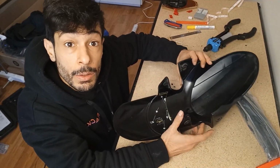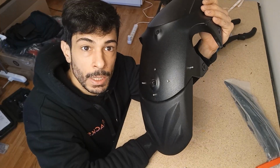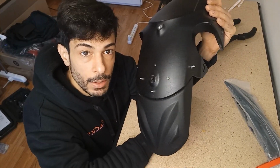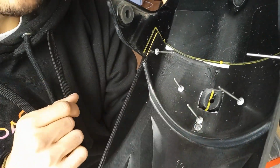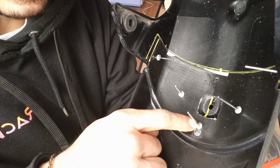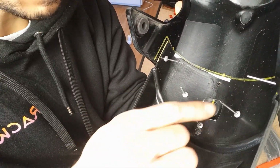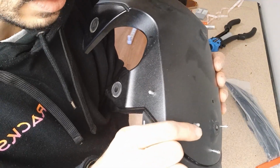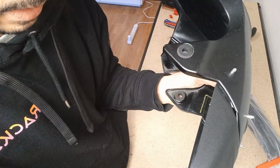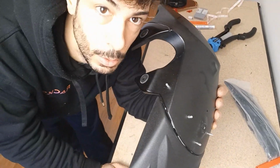New day, longer rivets. As you can see now, they stick far enough. So this time they are actually gonna clamp the pieces together. The reason why I have them placed like this is because this is the part that you actually cut off and it stays the flashiest. So I can grind this out with the multi-tool so they are smooth, because the actual riveting part is gonna protrude a bit. And I really don't like that close to my wheel. I don't know, call me paranoid, but I don't.